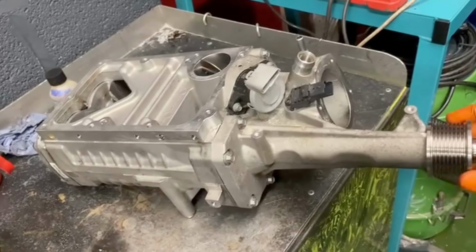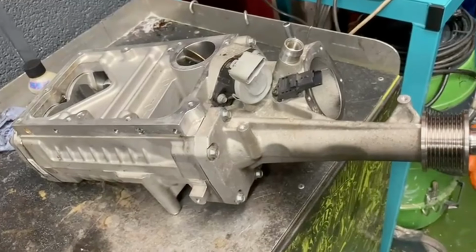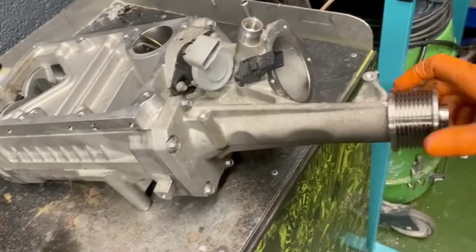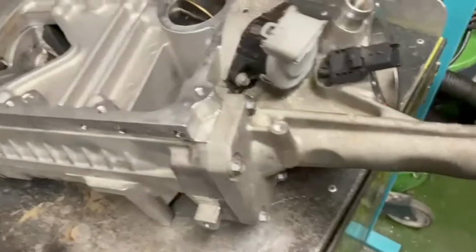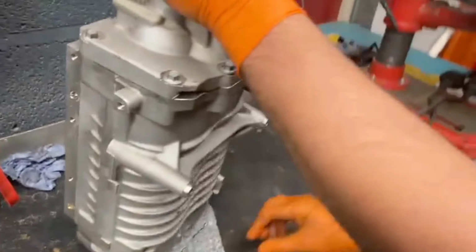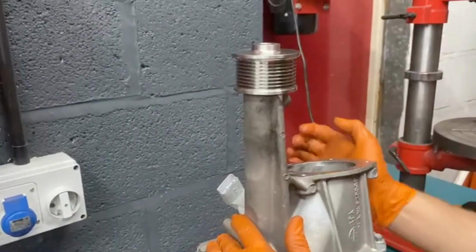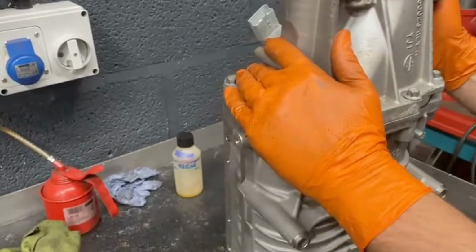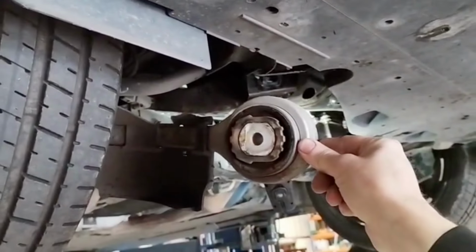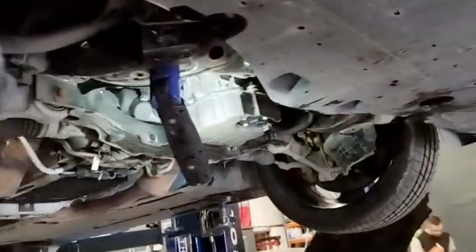Okay, just an update on this supercharger. You've got the video of it being very noisy, growly and rattly. Here it is now that it's been rebuilt. Pretty silent. And underneath we're going to be changing these banana arm bushes that can become a bit perished and a bit sloppy over time with our uprated poly bushes.